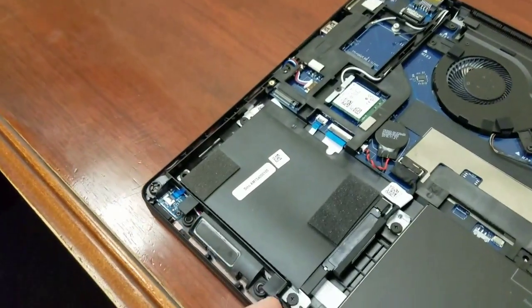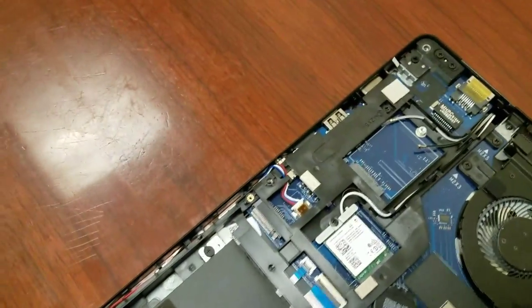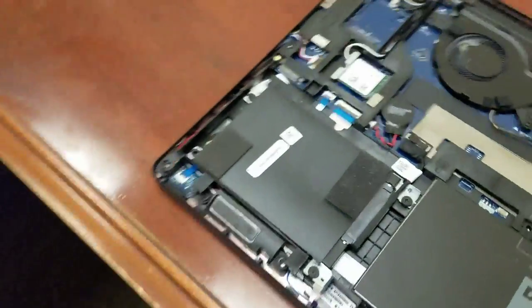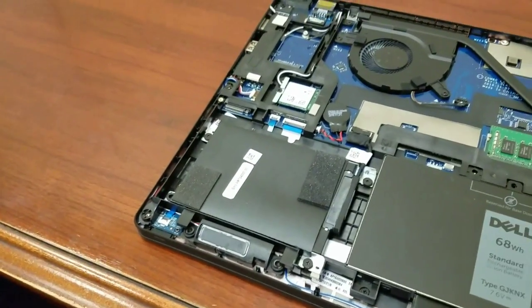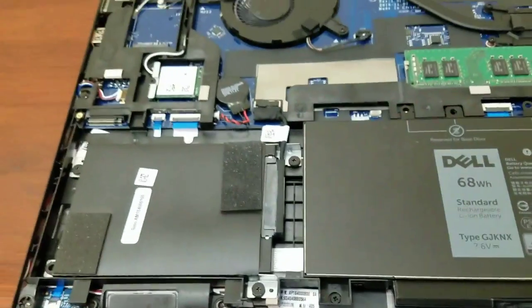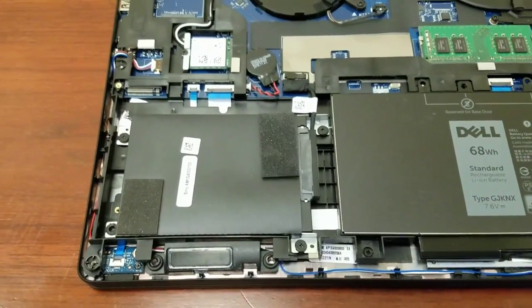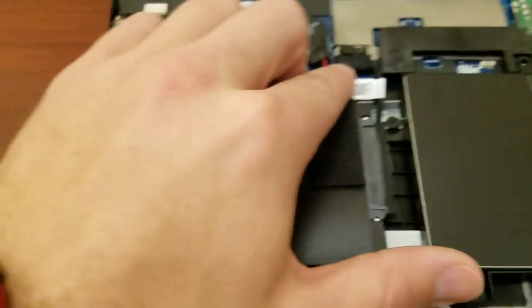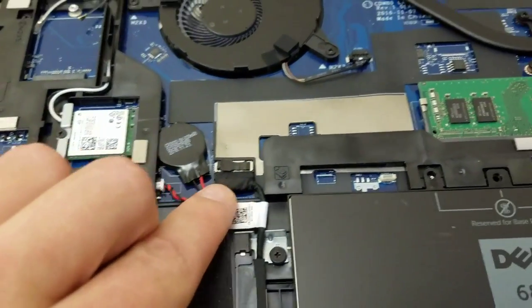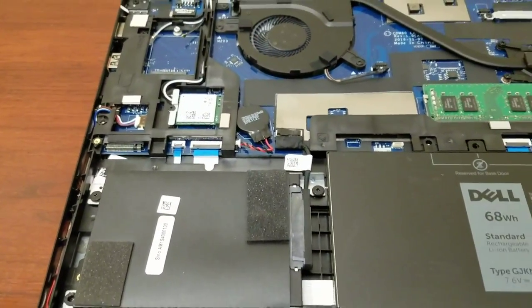This is your hard drive. You've got your carrier with three screws on it. So you just take these screws out and pop the carrier out. Along the sides of the carrier you have four screws, and as soon as you get those screws out you can just pop the hard drive out — super simple to do. You just want to unhook your connections first — your SATA and your power — before you take the hard drive out, because you don't want to rip your connection to your motherboard. This does pop out, but prefer not to because it's a little difficult to get back in.